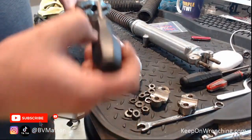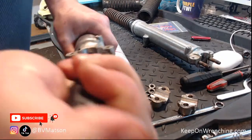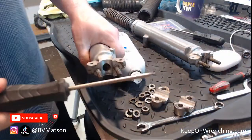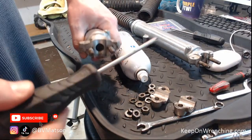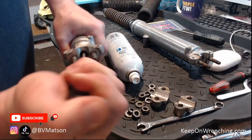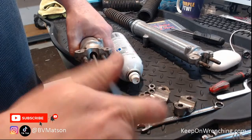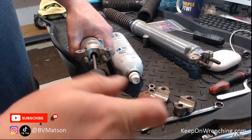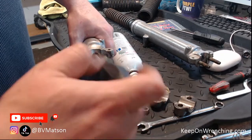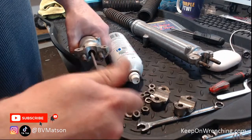And we're going to go in here again, down in here. This is a little bit too small of a JIS. If it moves or jiggles at all, move up a size in your JIS. All right. Oh, this one opened right up. I'm actually really surprised. This other one's got me a little concerned because it's a mess. I'll try to give you a good look at what's going on there. But what you want to do is take this bolt out.